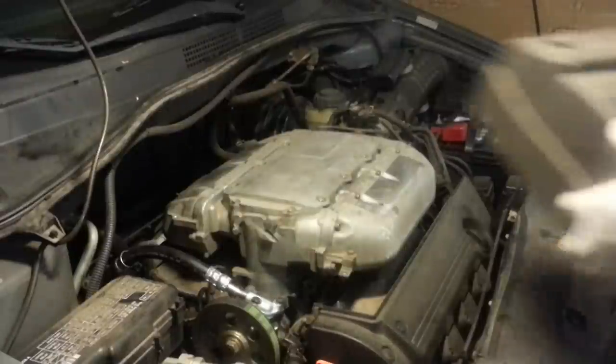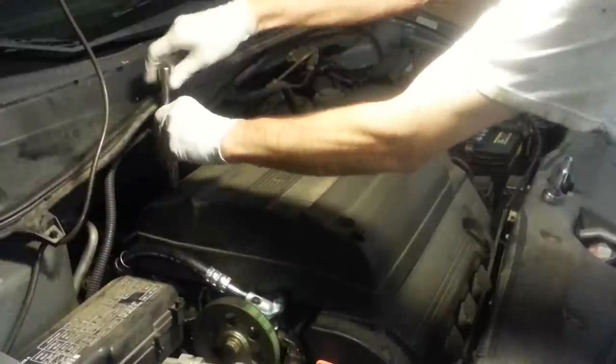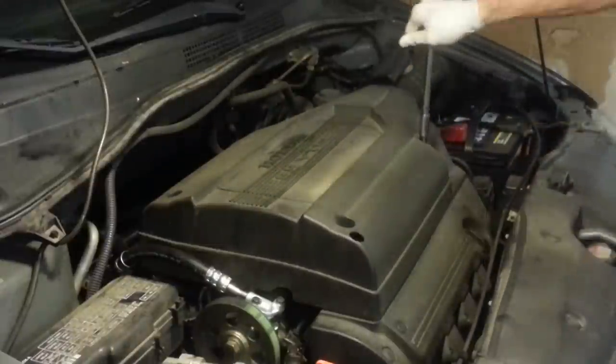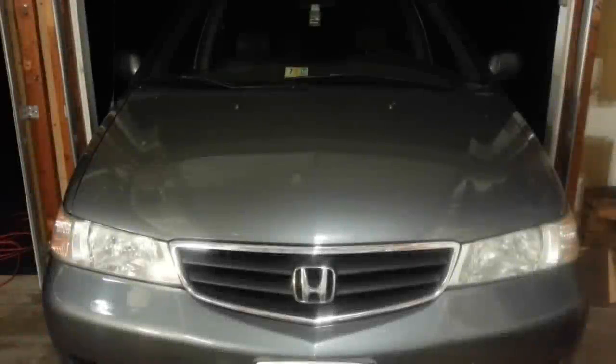Last thing to do is to replace the engine cover. That wraps up the job replacing the high pressure line on the power steering pump. I'm really happy with the result, but I must say it was much more difficult than I anticipated. Getting that flare nut loose was a challenge - it was really tight and I resorted to doing the proper thing and buying a set of flare nut wrenches. And getting the power steering line out once it was all disconnected, and getting the new one in, was a good bit more difficult than I thought it would be too. It was pretty challenging trying to find a means to work it around all the other hard obstacles and to coax it into place. Luckily I didn't have to bend it, but otherwise it went in just fine. Thanks for watching and we'll see you next time.